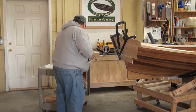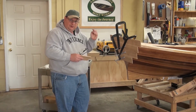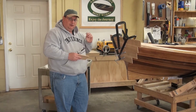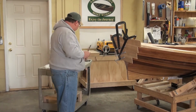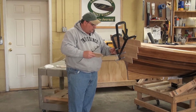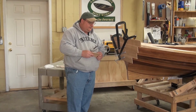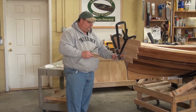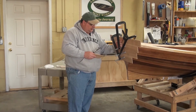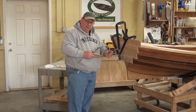I'm just going to use really inexpensive 3/4-inch screws that you would use for really thin sheetrock at home, or whatever you would use them for. But they're tiny, they're 3/4-inch. All I'm looking to do is hold these planks up against the transom while the epoxy dries. And then I'll go ahead and throw some clamps down the middle, or you could tie a line straight down the center and put screws in the middle of every one of these boards.